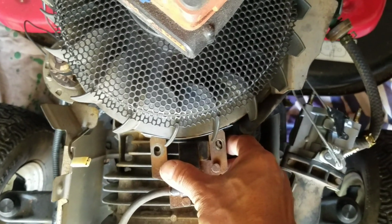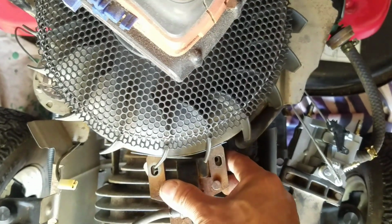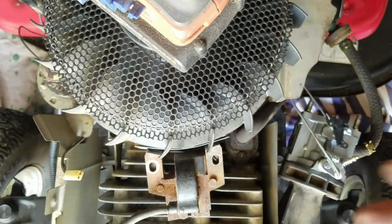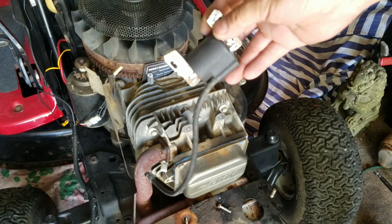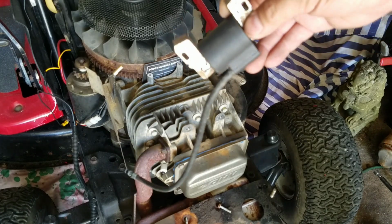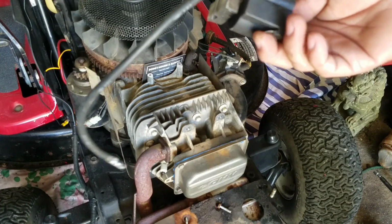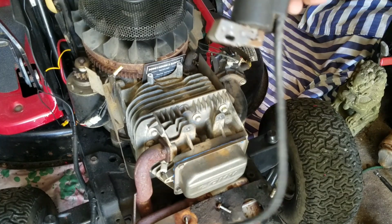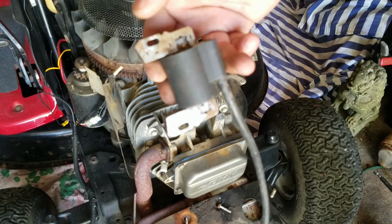It's off. See that? It's off by almost a half an inch. So this magneto's not going to work. Man, oh man, it's amazing what you find. See, I never throw things away. So I have a bin of parts, like, from everything, you know? This is a really good condition one. It's a little bit different than your regular stock Briggs & Stratton. I believe this is an aftermarket one. Anyway, this one actually says this side out.